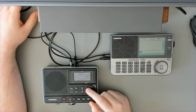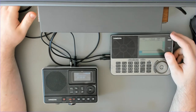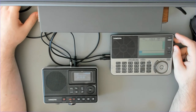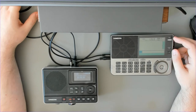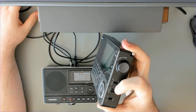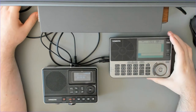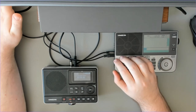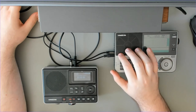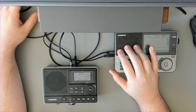Something some people may ask: do I actually need to have the speakers on to do the recording? The answer is no. The line out is not connected to the speaker volume and is not affected by the tone changes — we have three filters here: news, normal, and music — they do not work for the line out. So you do not need to listen to the radio to be able to record it. It's also a bit annoying that you cannot adjust the recording time because we have those 30-minute slots on the shortwave.